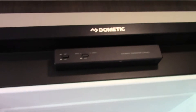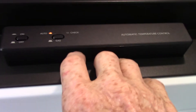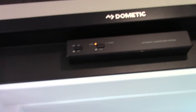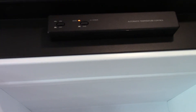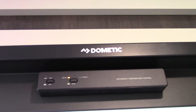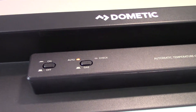Your refrigerator is a gas absorption refrigerator by Dometic. Because it's gas absorption, it'll run on 110 AC or LP gas. You're always going to choose auto — auto means electric, but it automatically searches out 110 AC and if it can't find it, it'll automatically switch over to gas. So if you have a power outage at the campground it'll automatically switch over to gas so you don't spoil your food. You can run it dedicated to gas, but even if you don't, if there's no AC power it'll eventually end up on gas anyway.